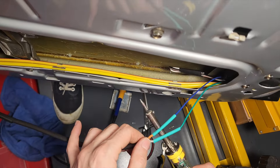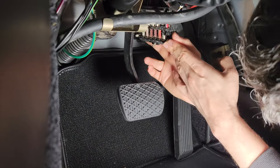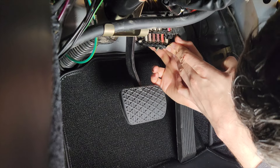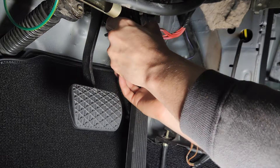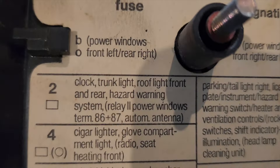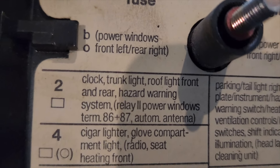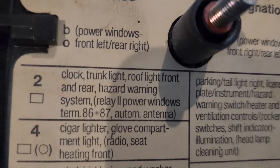The fuse block has been taken out - battery disconnected and fuse removed. MMWA has attached this to fuse number 2, which is the clock and other amenities that have permanent power. It needs to be permanent power rather than switchable, because you need to use your remote when the car is not on. You can see all the things that have permanent power on number 2.